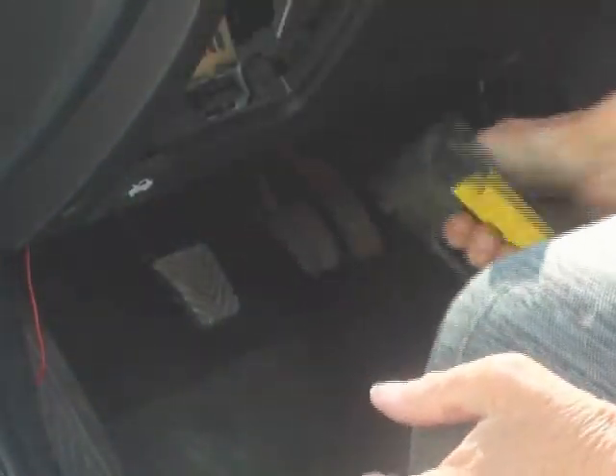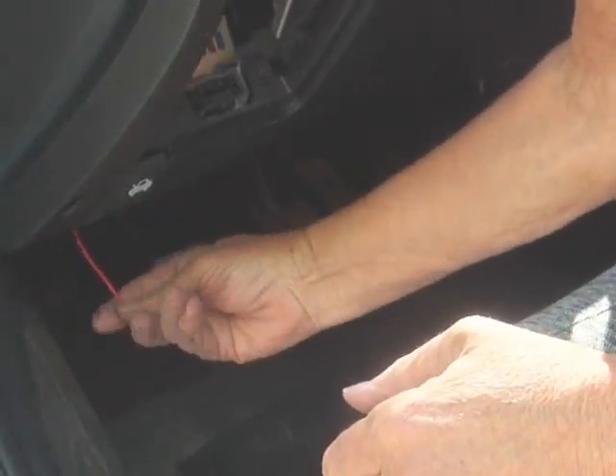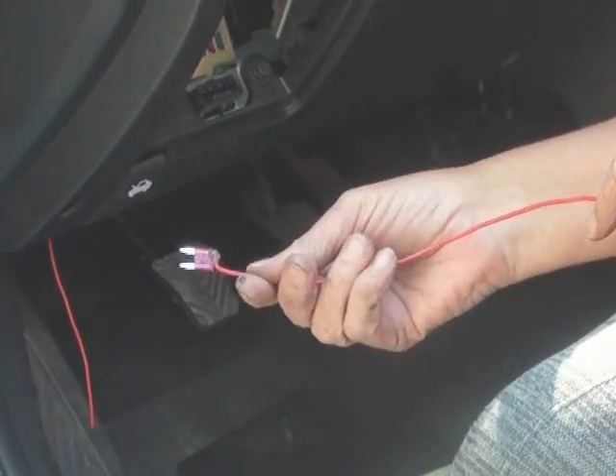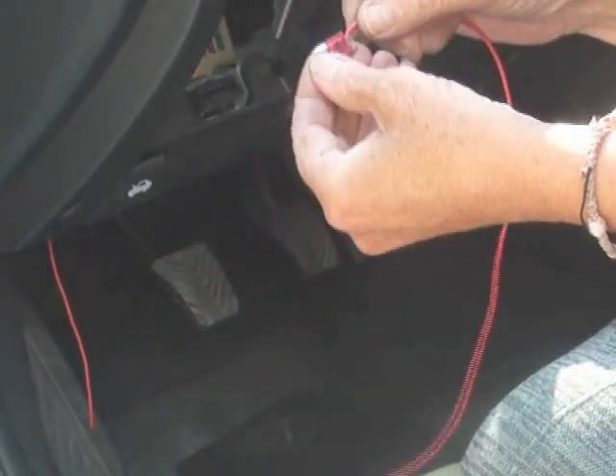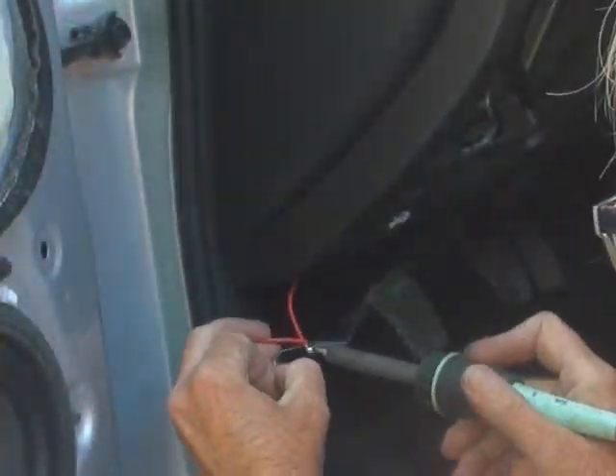The power needs to be hooked up properly in the fuse panel. I tried soldering to the fuses, but fuses are no longer solderable — which was a surprise, it was just soldered to the plastic. So I ended up making a brass clip with an inline glass fuse.